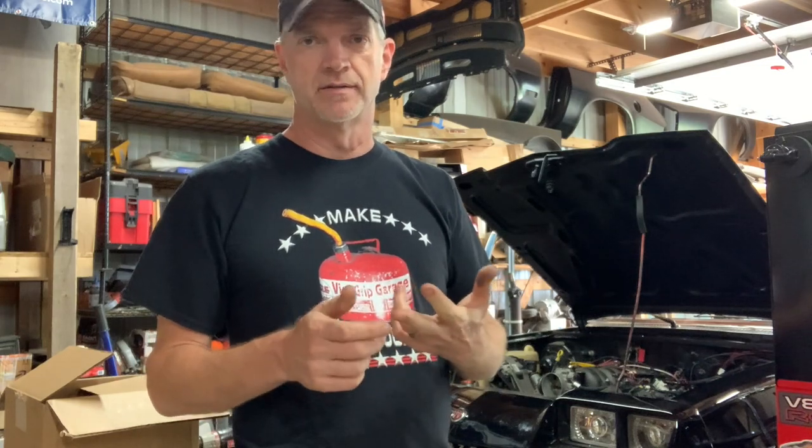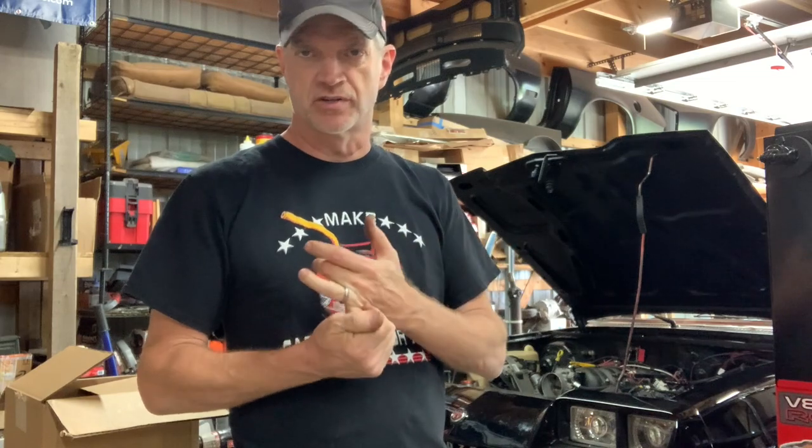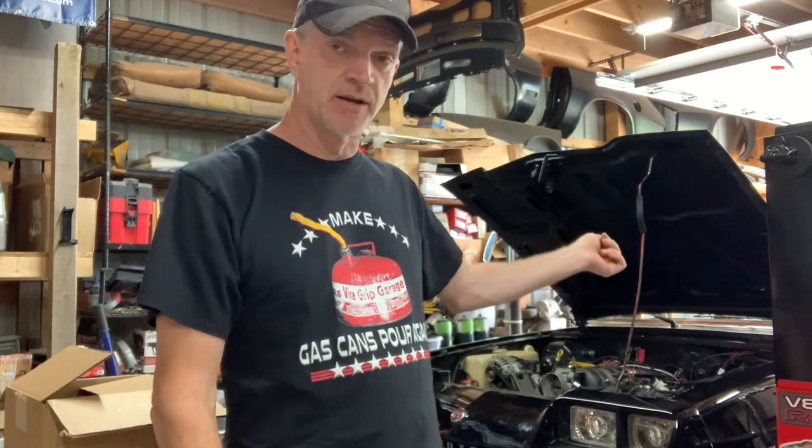Once you download that software, if your injector number is not listed, you just do a custom configuration for an injector where you give it the flow rate, the PSI, injector on time, injector off time. Put in those parameters, save it as a custom tune, download it to the SD card, take the SD card back to the handheld, upload it within like three clicks, and reset your TPS, because every time you put a new tune in, you really need to do that. Then you should be able to fire the car up.